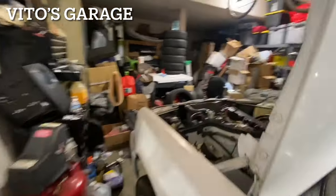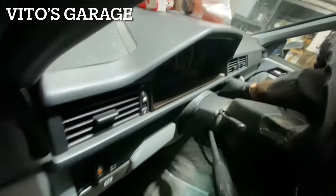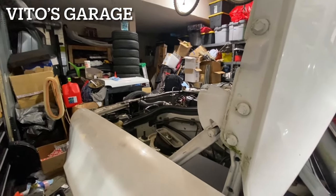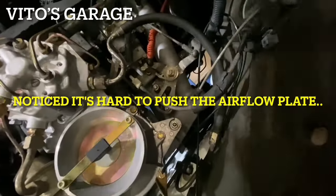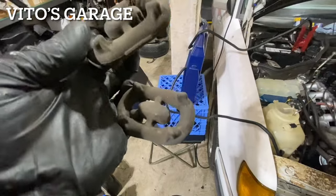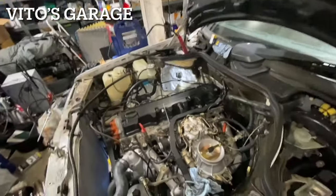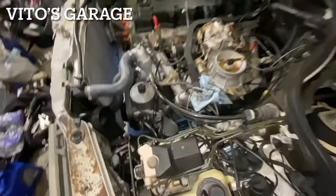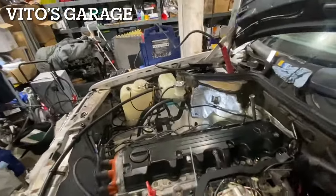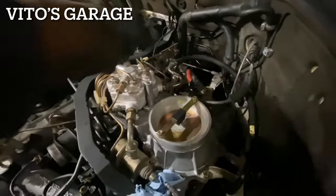Something strange just happened — I have no idea why it's doing that. I also changed a couple of exhaust muffler mounts in the rear. If your coolant isn't draining, make sure the car is on level ground — when I lowered it all the way down it was still at max and wouldn't go down. I only put in about half a gallon so I started shaking the car and it started drinking it.